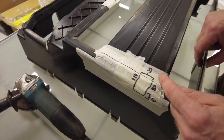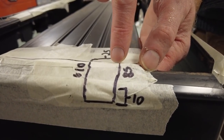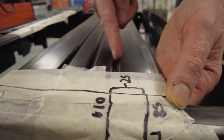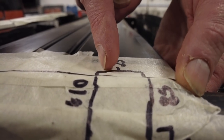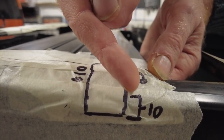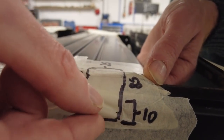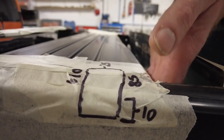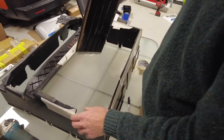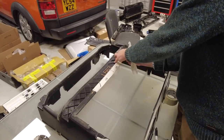Then you need to do a little bite out here. Land Rover tells you it's 85mm from here and then 25mm — so 110mm total — and that top line is in line with this crease. Then come back 25mm, and they tell you to go around the corner 10mm. Do the 10mm down there and you end up with that shape. I've saved everyone the horrible noise of the vibration cutter.